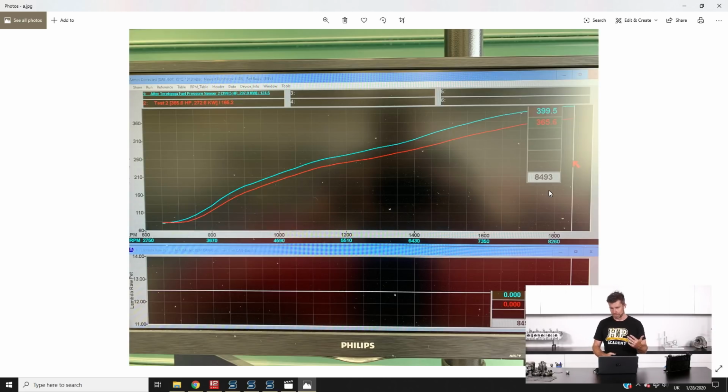And that really leads me to what we're seeing on the dyno screen here. The best run we've got here is the blue run, 399.5 horsepower. That was after we raced the car at Teretonga last time. That is a little bit of an anomaly. The car normally produces about 384 to 386 horsepower at the wheels. The 400 horsepower run was with the front bar removed, and it gets a lot more air feed into the intake system.